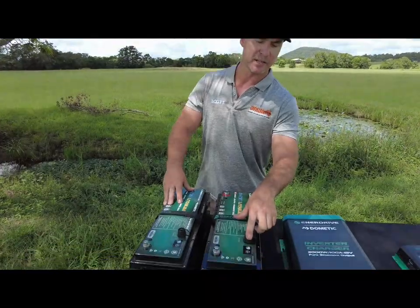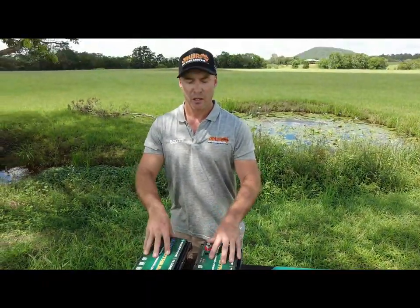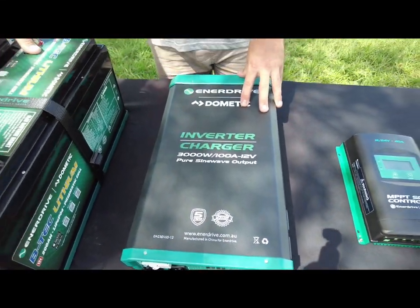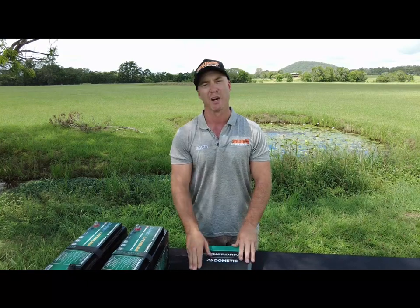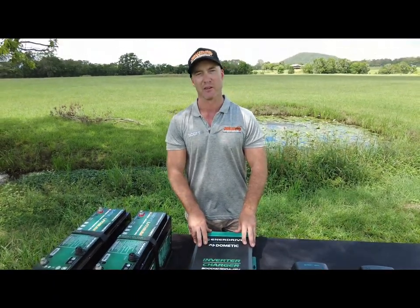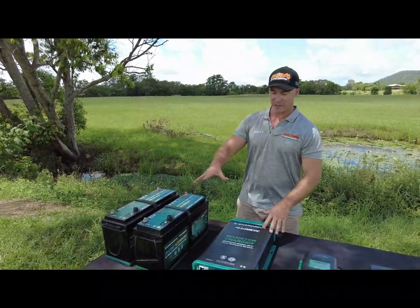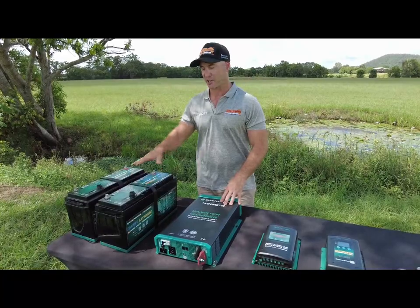They do have their flat battery reset, as well as you can use the charger to kickstart these if they do run flat. Along with having these two 200s, we have a 3000 watt 100 amp inverter charger. With having such a big inverter and a lot of battery power, you can run your aircon while you are off-grid, as well as other products — so you've got up to 3000 watts. This is a pure sine wave inverter, and when you are charging the van, this charger will charge the van up to a max 100 amps an hour. If you do happen to run flat, 400 amps will be charging these back up to full in four hours — great if you are on the road. Whereas other manufacturers are using small 25 amp or 35 amp charging, and you'll be out there for hours trying to recharge so you can use your fridge and stuff again.